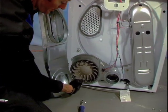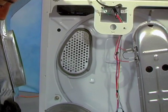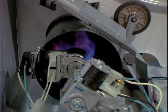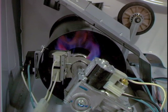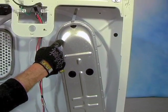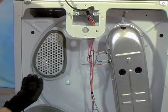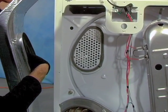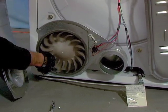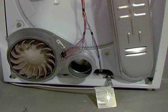This blower actually sucks — it pulls air into itself from the drum through this housing and out through the dryer's duct. As it pulls air from the drum a low pressure area is created. This effect creates the wind that will draw the heat generated by the burner into the drum to dry your clothing. Air flow is crucially important if the dryer is to heat properly. For more information on air flow and troubleshooting heating related problems, watch the troubleshooting heating related problems video at applianceassistant.com.